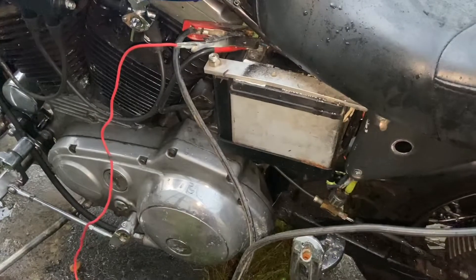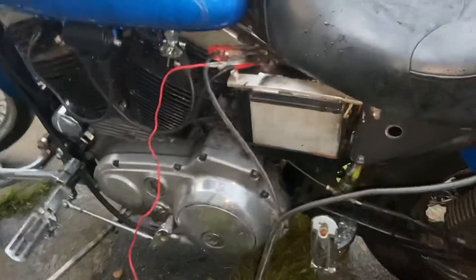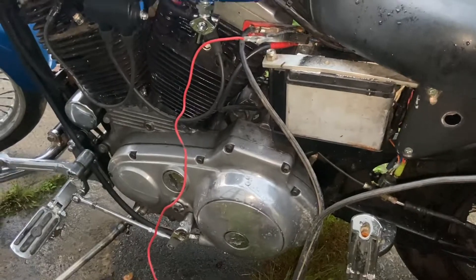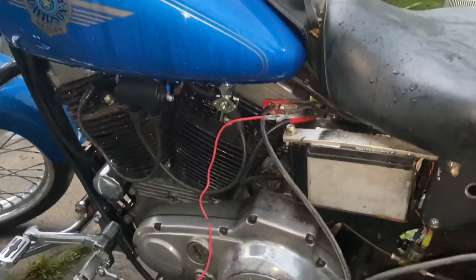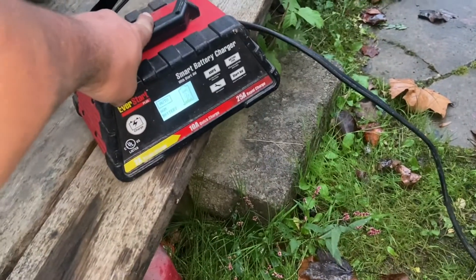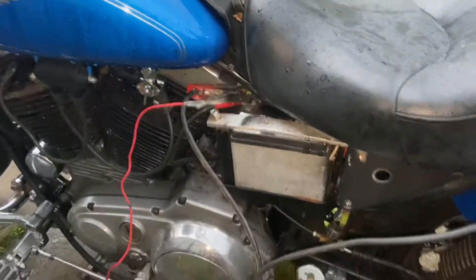That is how you can normally bring an AGM cell back. Sometimes it just doesn't work, sometimes the battery is bad, but I've had this happen quite a bit with larger car audio batteries. It works on a motorcycle battery too — you just gotta give it a little jump for the smart charger to pick up on it. Hope it helps.